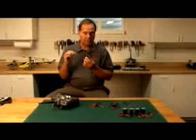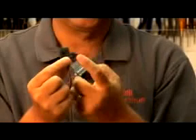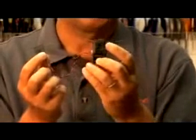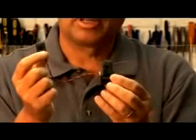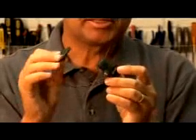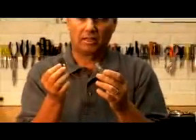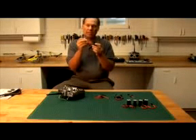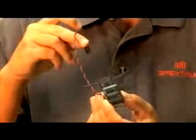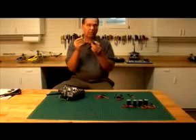The first thing you're going to notice with this receiver is there are two distinct parts. These are actually two receivers. This little unit that I have separately attached with this six-inch lead is a receiver itself, and you'll see two antennas, with another receiver housed in the main portion of the control unit. The real key to making DSM work is having this remotely mounted receiver about two inches or greater away from the initial receiver, and ideally these antennas will be oriented 90 degrees — perpendicular — to each other. This allows each receiver to see a different RF environment, and that is the real key secret to making long-range, full-range systems work for all types of aircraft.